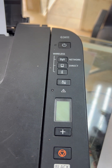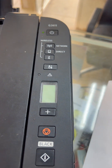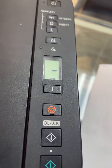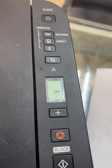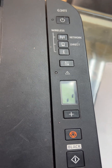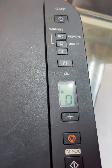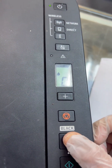Let it turn off, then turn it back on. The printer turned off. Now turning it back on — it's initializing, just hold on. There is no P07 error, but the printer is showing one ink light. I'll press the copy button and this light will be removed. No P07 error!